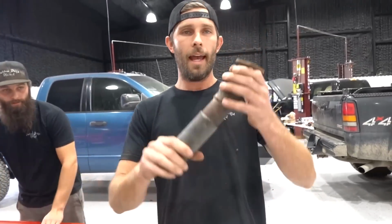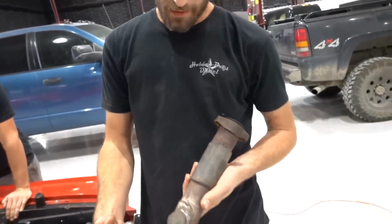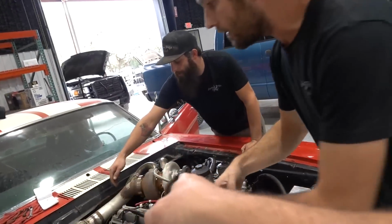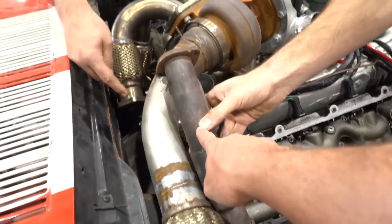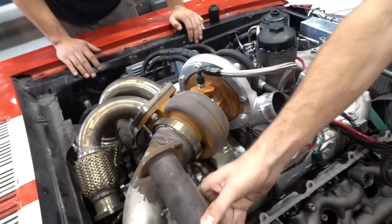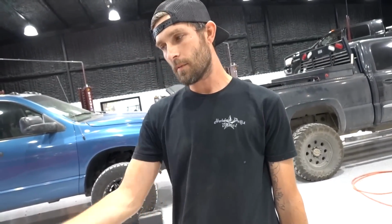Bottom line is, the inside of this pipe, which is what goes from the exhaust manifold up to the turbo. It connects the cylinder head up to... Exhaust comes out right here, and it goes through this pipe to this guy. To right here, to our turbo. So we were cranking, and it was holding pressure on the exhaust stroke. Not supposed to do that. And he goes, hey, something's plugging the exhaust. We're like, no, there's not. Yeah, no way. He's like, no, there is. And we pulled it apart, and there was.